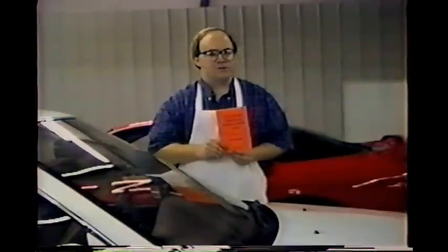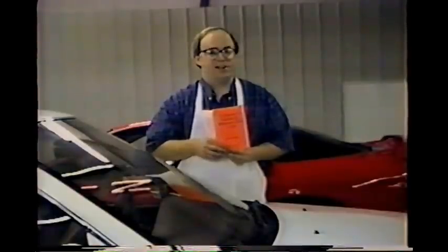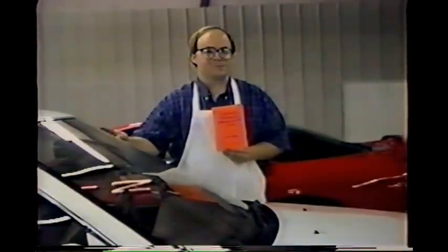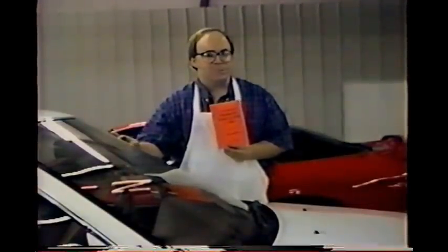In conclusion, don't start practicing on a car. Go to a body shop and haul off an old hood or old door and practice on it — a lot of body shops will actually pay people to haul off their old sheet metal. At the very least, buy an old dented hood for next to nothing. Please practice on scrap metal before you work on a car, because it will take a few tries before you get one right, and you don't want an ugly dent repair on your own car or a friend's car. Also, if you can't see a dent, you can't fix it. Adjust your lights as many times as it takes — if it takes a hundred times to get the light right on the dent, move it a hundred times. Concentrate on where your tip is, see it in the light, and work the metal from there.